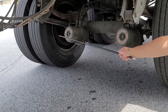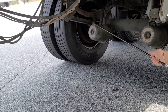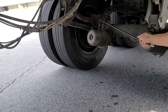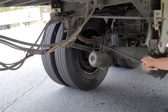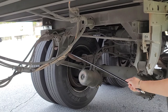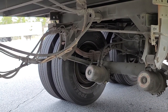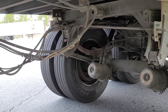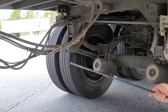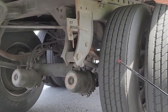My brake drum — that big piece over there — has no illegal welds, it is in good condition and securely mounted. All of my springs are present, none are missing, I don't see any cracks or damage to the springs. The spring hangers on the front and the back are in good condition, securely mounted, no damages, no cracks.